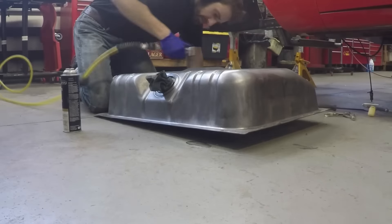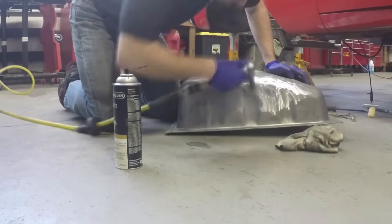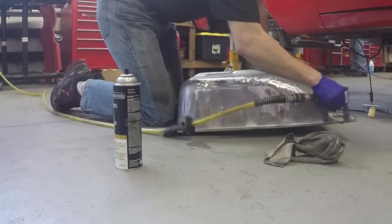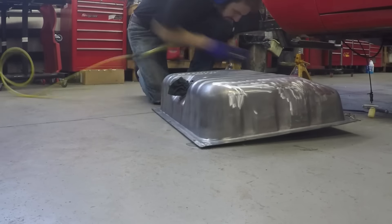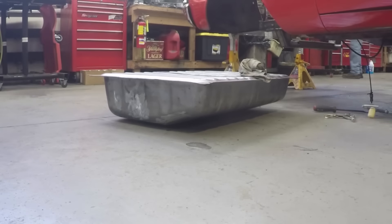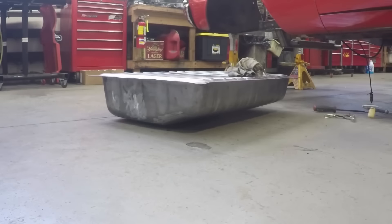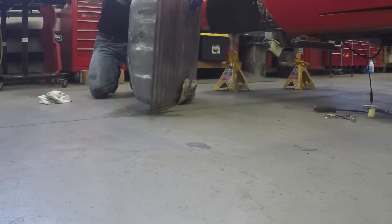This gas tank was unpainted so there is a little bit of surface rust I need to take off, and I go through a lot of brake clean at Bruce's shop. The thing about brake clean is that it dries with no residue — that's why everybody uses it. Before you paint something, it's good to spray it down with brake clean because that strips off any oils, even oil from your fingertips, so you have a perfectly dry clean surface on which to paint.